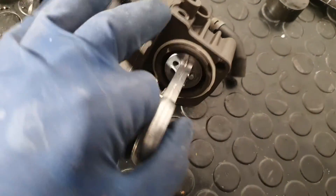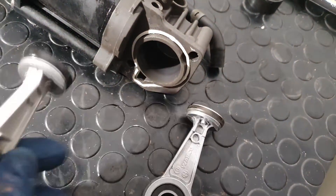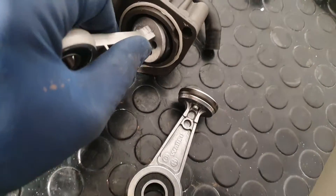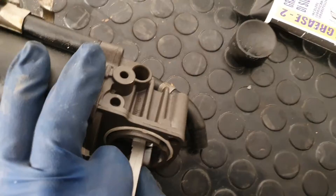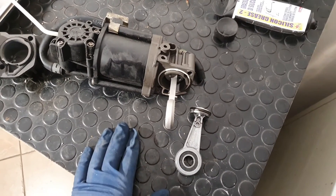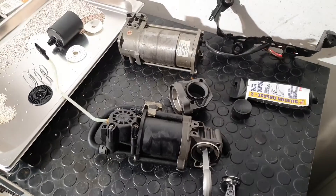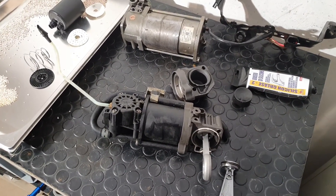When I put the old piston in with some silicone oil to prime, it moves quite easily up and down. But when I try the new piston, it requires considerably more effort to move inside — so I believe the new piston will effectively improve the compressor's performance. That's all — I'm going to finish connecting everything back and hope it works fine.